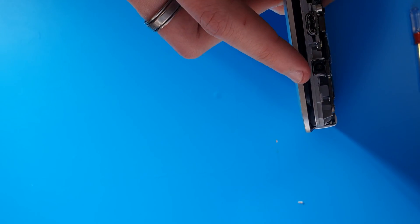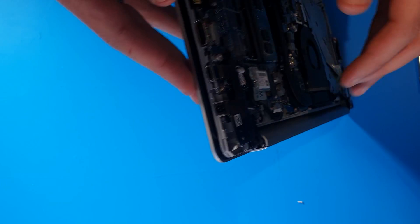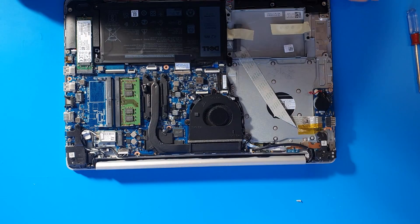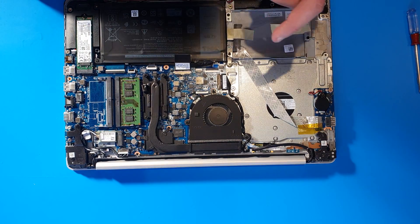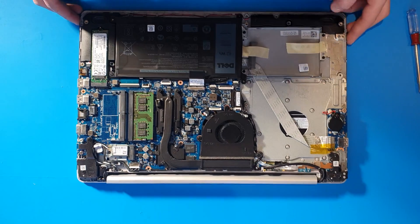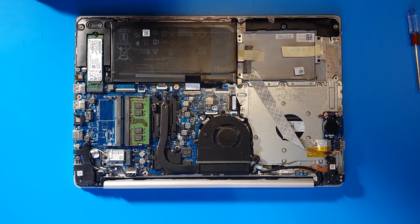The charging port is very common for these to go wrong — the center pin can get damaged through wear or heavy use. Another issue you could be facing is the 'plugged in not charging' error or a communication error with the PC. There are three communication channels: the BIOS, the battery, and the adapter. If something's wrong there you'll get an error — it doesn't always tell you clearly, but always try replacing the adapter first.